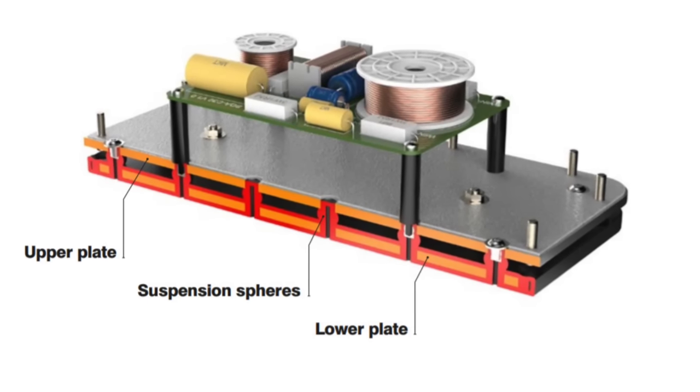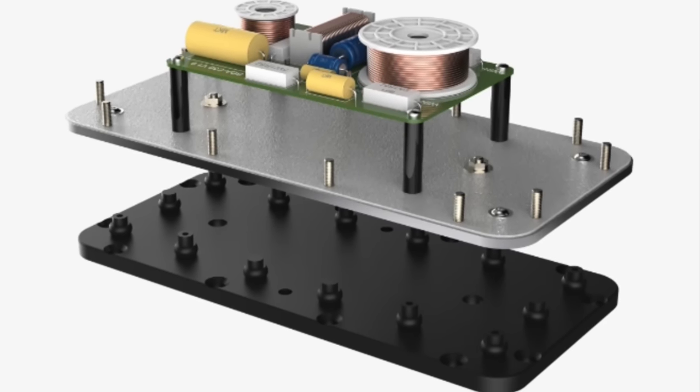The Concept 50 has a two-plate suspension system that Q Acoustics says isolates the cabinet from interference caused by internal vibrations. Q Acoustics has mounted the crossover to the isolation base, keeping it free from vibrations and mitigating any electromagnetic influence from the drivers. You'll note that isolating the crossover from cabinet vibrations and driver interference is standard fare in well-designed high-end speakers. Q Acoustics says that what you experience as a result of that isolation is tighter stereo imaging